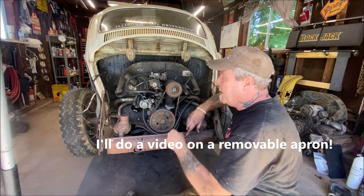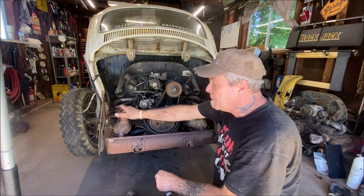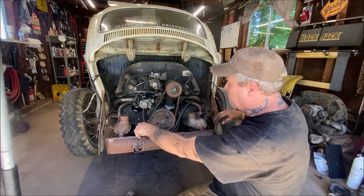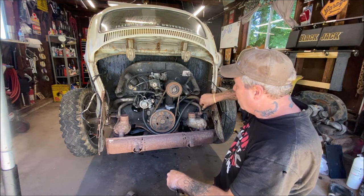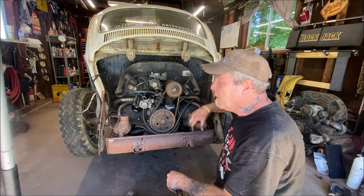That would be going around the back here. So you would remove your hoses from the muffler barrels, lift that tin up and out of here. There's a couple screws that hold it on here, on the side. You remove your heat riser, little brackets right here, and you would pull that rear tin off of here, okay?